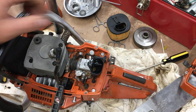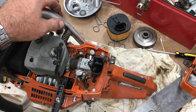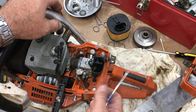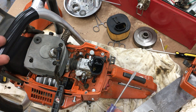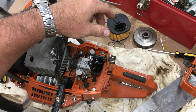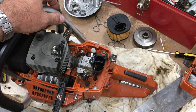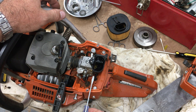By the end of the day I was having trouble with the saw idling — it would only idle for a few seconds and then die, and was a little hard to start. I screwed the low screw in to bottom and back out and it had moved about a half a turn. I repeated it the next day cutting some big rounds and ran about an hour — it moved again, about an eighth of a turn — and just a little adjustment got it back to where it should be.